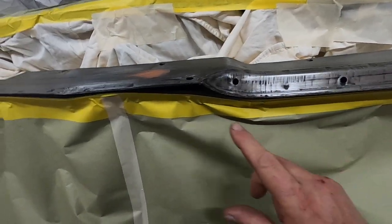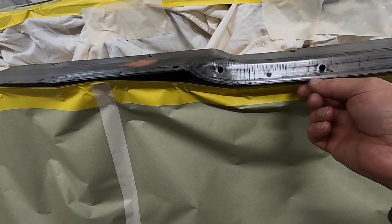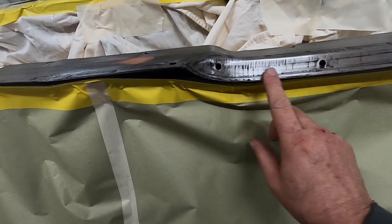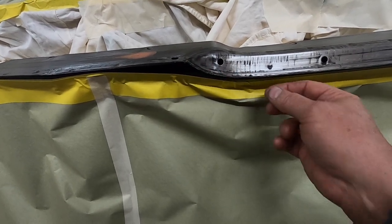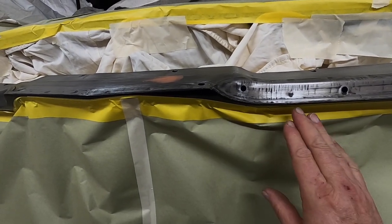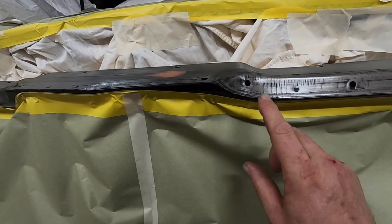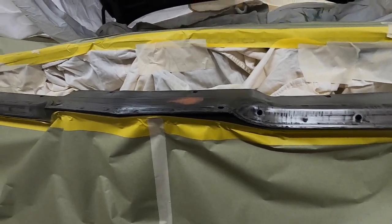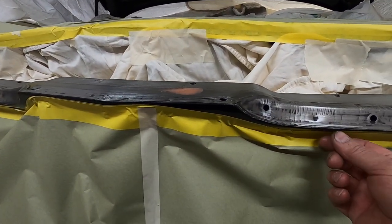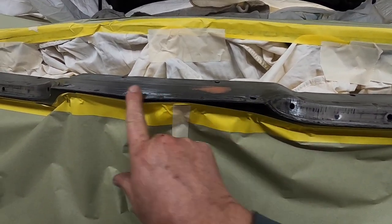I might just mask it first. I taped it like this - the tape I put on here I'm going to move a little further up for priming. Then I'm going to lightly sand these edges so there's no bumps, and tape it back further when I tape it to paint so there's no primer under the paint. It's black paint underneath, so I can lightly hand buff any line with maybe 1,200 grit. But you're not going to really see it anyway - it'll be underneath the trim.